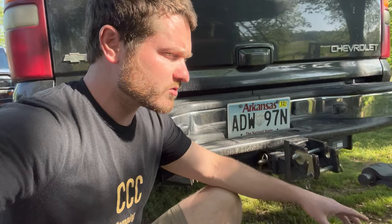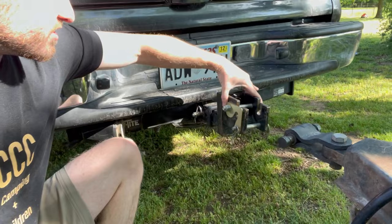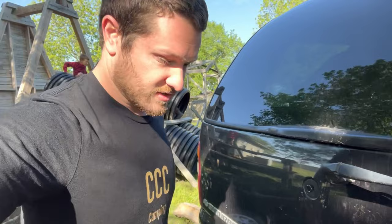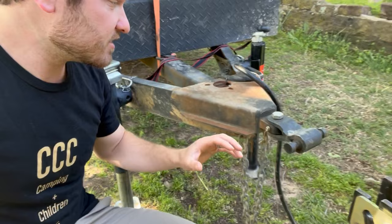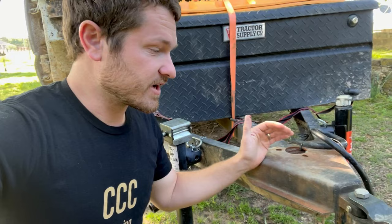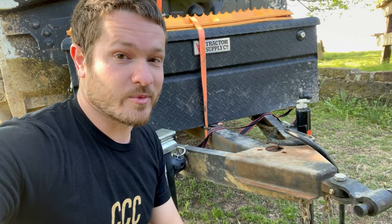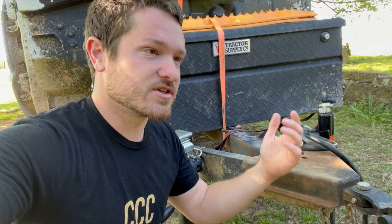Most of Lock and Roll's hitches are rated the same. This comes with the whole V portion and all this, and then you get the vehicle side separately — they've got several different ones to fit different trailers and tongue types. This assembly is rated for 11,000 pounds of trailer and 1,100 pounds of tongue weight. I believe our camper's tongue weight is under 1,100 pounds and the camper is definitely under 11,000 pounds, which covers most trailers — way more than most teardrops and basic off-road trailers need.